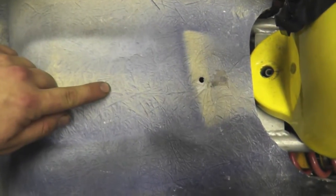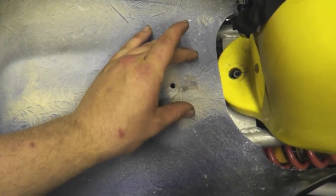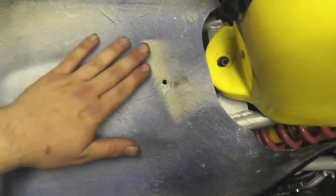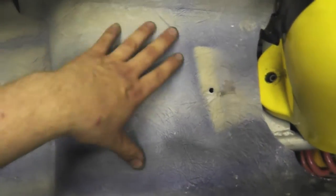Yeah, cut it there, sort of wider there, really narrow there. Stretch it together at the front. Mat it over after roughing it up so it can grip and compound in there. Strengthen it up some more as well, because this is just fiberglass and some points are weak. As I said, do not sit on it, and it should be a lot closer together.